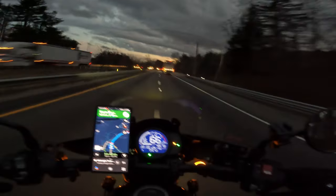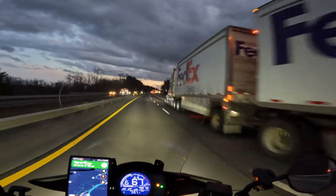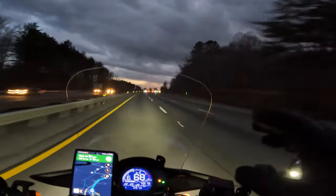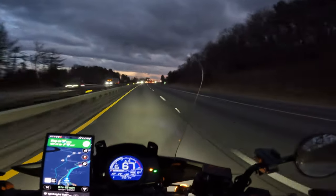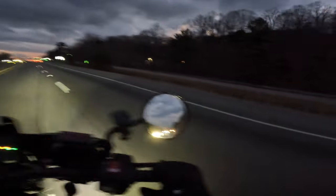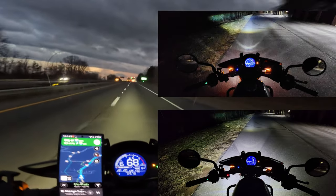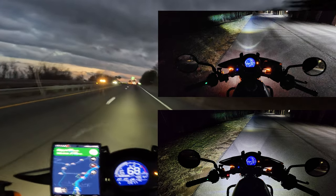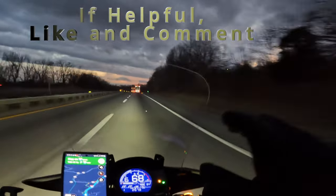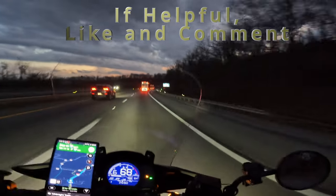Right now I'm overtaking and visibility is actually quite poor — check this out, see that difference? And it's not even dark yet. Wait till you see it when it's dark. They're positioned so they're not blinding drivers coming in the opposite direction. The daylight running lights are focused close to the bike — think of them as a floodlight right next to the bike. I'm going to include a picture of just the daylight running lights at night so you can see. The D2 driving lights I positioned to where the actual stock headlight is, so it enhances and magnifies that lumen value.